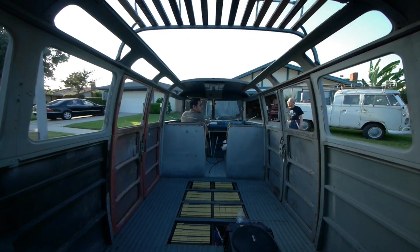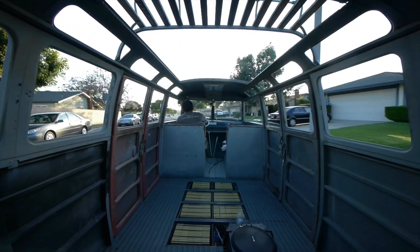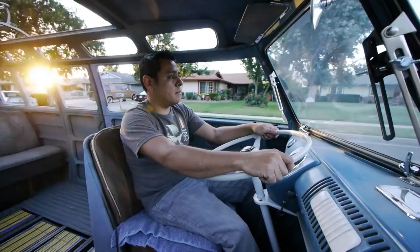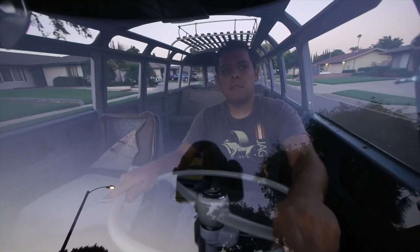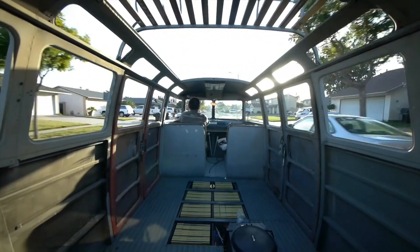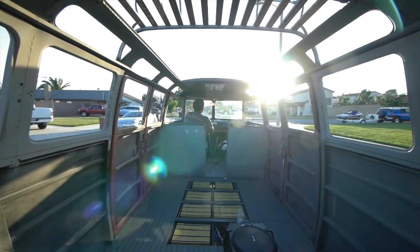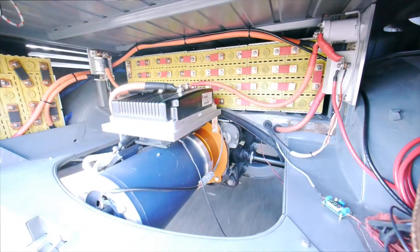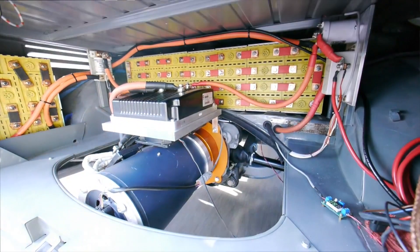One of the main reasons for all the work ahead is that one of my original goals for this vehicle is not yet met. I originally set out to build an EV that would drive 100 miles or more between charges. In its current form, the Samba has given me a maximum of 65 mile range, and even though there are things I can currently do to improve on it, like cutting down drag by installing 20 of the 23 windows, I'm afraid the only way to reliably and consistently meet my range goal is to change the current 21 kWh lithium iron phosphate battery with something bigger, but yet lighter.